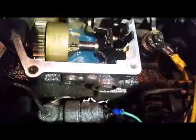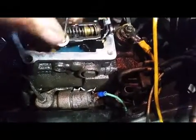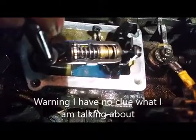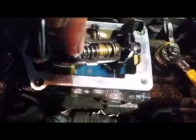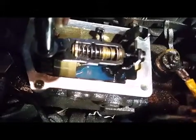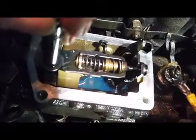The literature online indicates it's not necessarily required. When you think about it, the spring that comes back from here actually pulls that back in, because this sits in here. The throttle pulls that back and forth as it rotates. If it's fully that way, it bangs up against the housing, and that spring would give it a little extra push away — but I think that's affected more by this adjustment here. I'm not going to put a spring in there, because it's obviously worked for 250,000 kilometers already without it, and it doesn't appear to have been modified or taken apart before me.